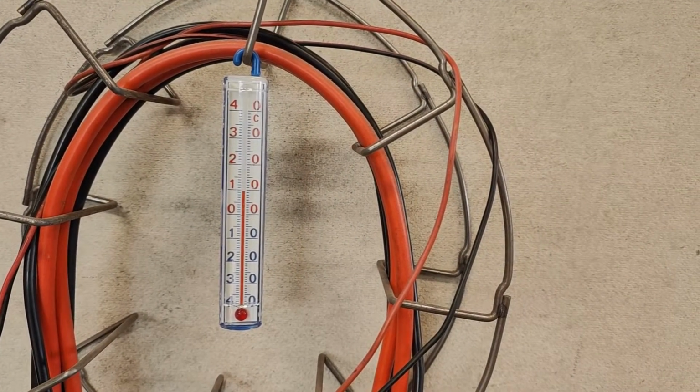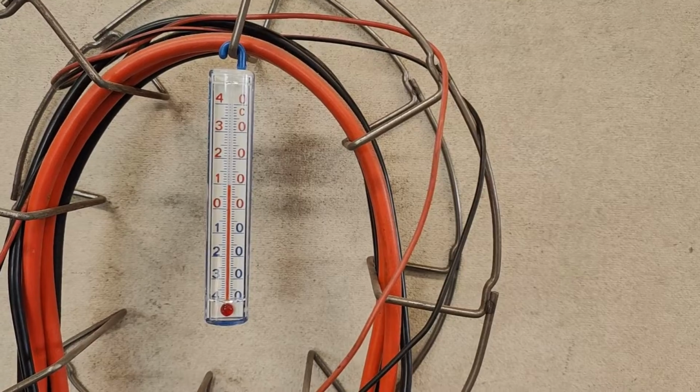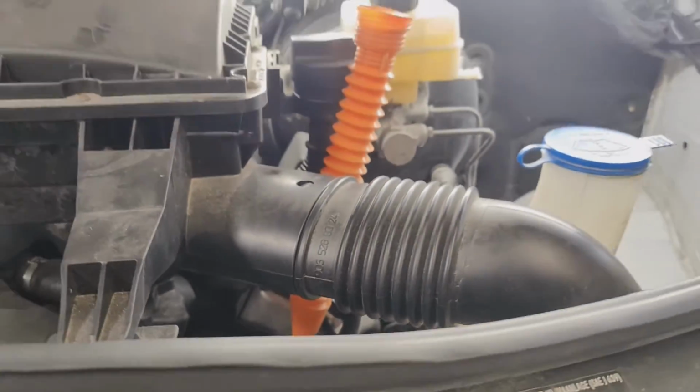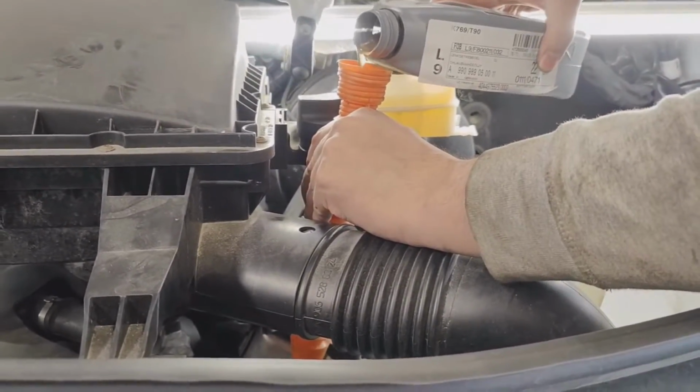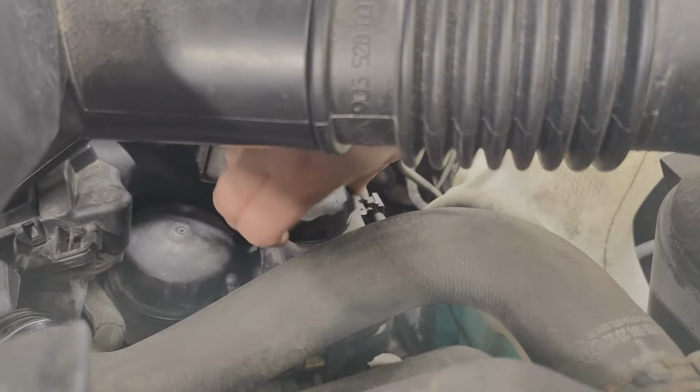The power steering fluid is temperature dependent, and now the temperature in the workshop is +10 Celsius. Just for the record, it is much easier to bleed the air out once you have closed the reservoir cap.